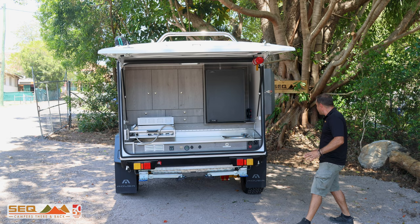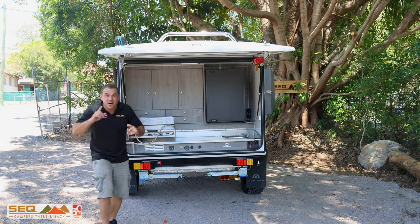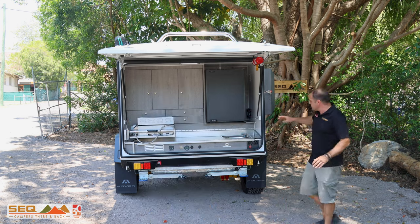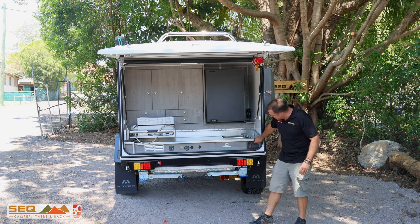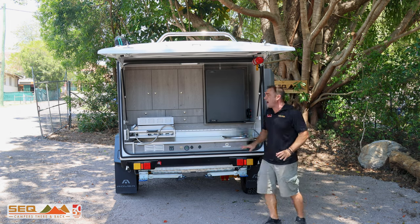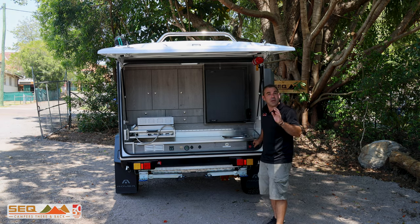I can see that I've got about 120 millimeters that I can use to level up the van. I've dropped one side down to 5 PSI and got the other up to 60 — those are my max level setup. Now let's just put that back — we're ready to camp.